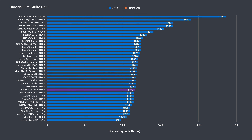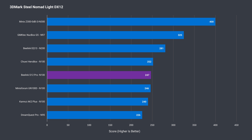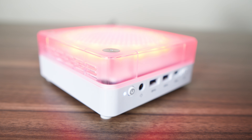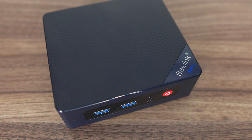With its DDR4 stick, iGPU performance falls below DDR5, but the difference between it and the top result is small in DX11 and DX12 — around 2.5% slower than a DDR5 N100 mini. One thing to be aware of: the lower the price you go in the budget segment, the higher the diminishing returns. If you throw in an extra $50 US or so over the N100, you can get something much more powerful, like a mini with a Ryzen 6600H. That said, fastest doesn't mean best in every usage case, and what Intel N100 minis often accomplish is being smaller, with less fan noise, lower power consumption and heat — and saving $50 is always welcome.